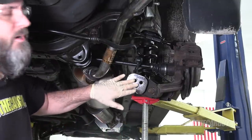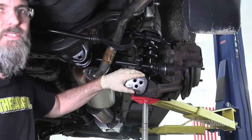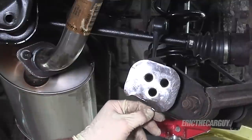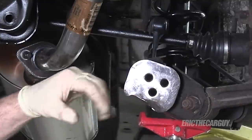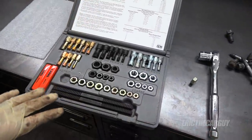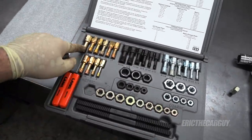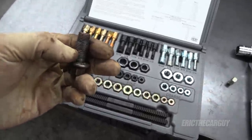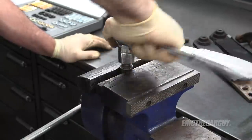I'm doing this because I've got a new part going on to a mating surface that has corrosion on it — I want to make sure that when the new part is fastened down there's no corrosion under it that can cause the fasteners not to hold as well as they should. I also notice there's a little lip at the bottom which may orientate the rest of the arm. I busted out my thread chaser kit — looks like these are 14 by 1, which I have. I'll use the thread chasers to clean things up and that will also help ensure good thread engagement.